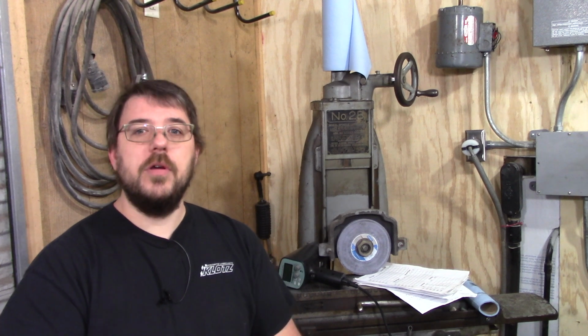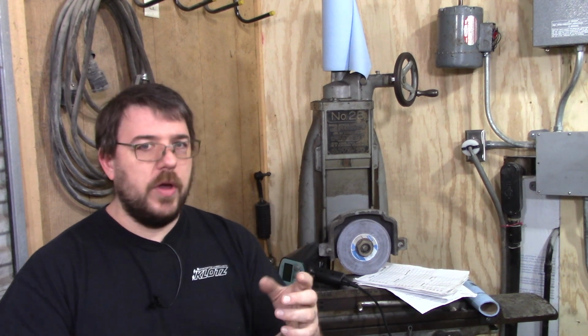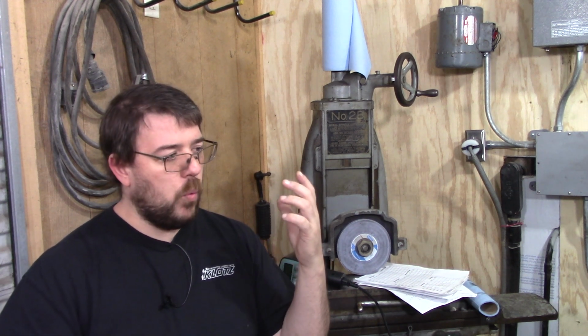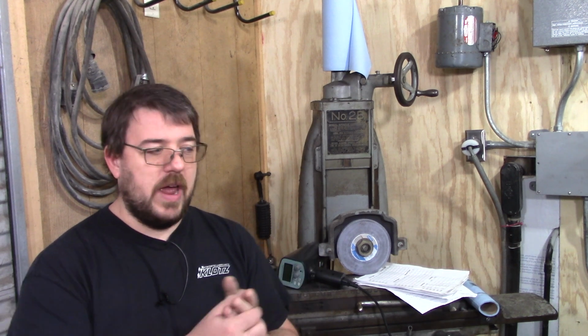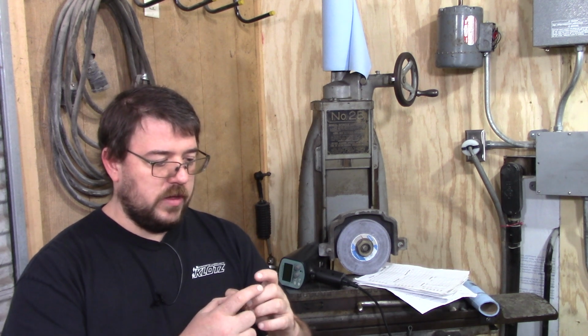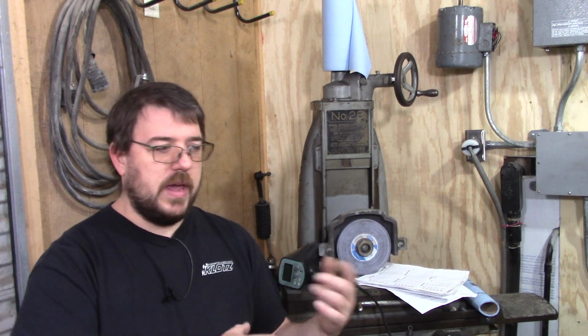As mentioned earlier, the hydraulic lash adjusters made it so that measuring the exact duration and lift was going to be tricky. What was going on is these Monkeywrench racing springs are really stiff, and we'll get into that discussion in a little bit here. But essentially they were collapsing the hydraulic lifter. When I was setting up the 2AR, which has pretty much identical valve geometry, that didn't have that issue. The hydraulic lash adjusters stayed fully pumped up while I was measuring, and that was wonderful.